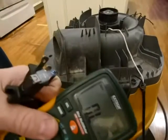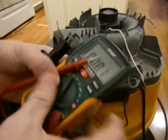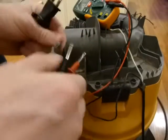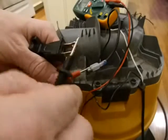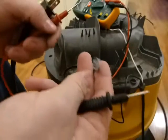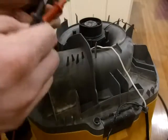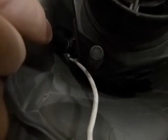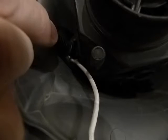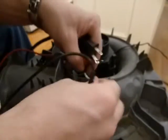I set the instrument — just a voltmeter — to continuity, where it makes a sound. I plug one probe here, and there is continuity from the hot to the part of the wire that goes to the switch, so this part of the wire is good. I'll check the white one as well, hooking it on the neutral through the hole. Good — I have continuity there, where the connector is at the end of the white wire. So the cord is good.